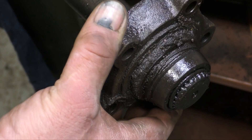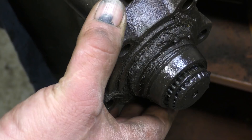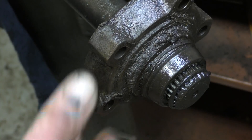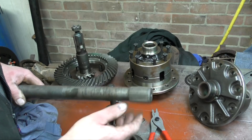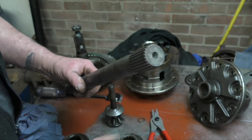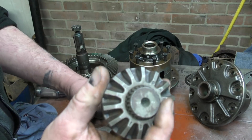The drivetrain starts at the drive flange, which is bolted to the hubs. If you have a two-piece one, it fits to the half shaft — and you can see that's worn. This is a reason for drivetrain failure or losing drive. What you need to do is check your half shafts. You obviously take them out to get your diff out, and make sure the splines are not badly worn. You can usually see if they're chiselled — that'll be where it's shiny on the half shaft.